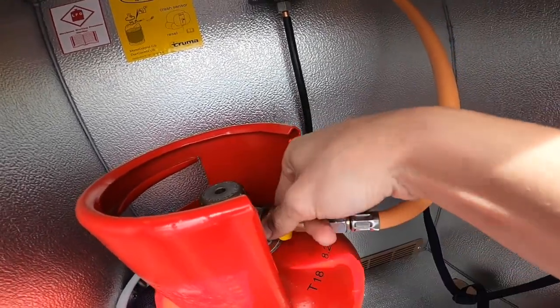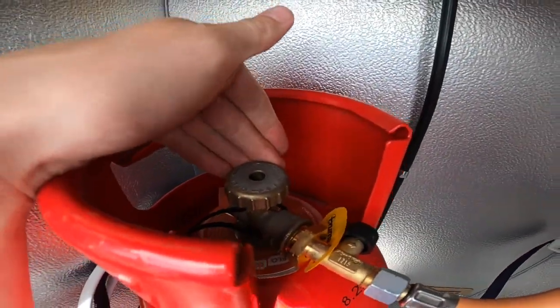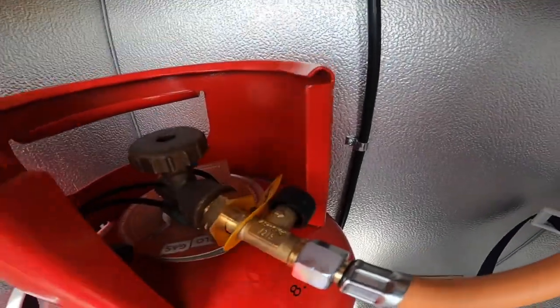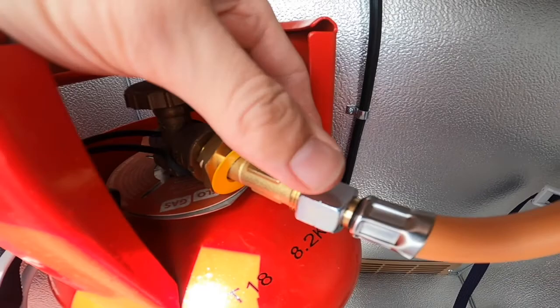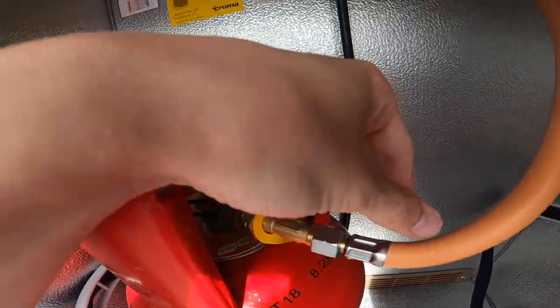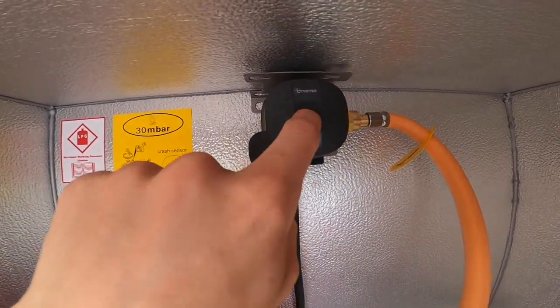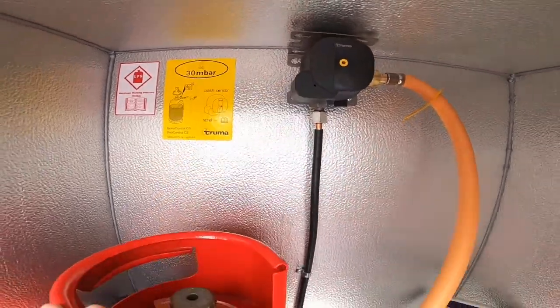Then you need an adjustable wrench or a gas spanner, like I've said, just to nip it up. You turn on and off the top of the bottle; turn it off when you're traveling and make sure it's strapped in. And then when you've turned it on, if you just press this black button here, the crash valve on the pigtail, hold it for 3 seconds, it allows the gas through into the vehicle. And then finally just check this one is pushed in. Should it not be pushed in and popped out, it's just a crash sensor, it's just for safety.